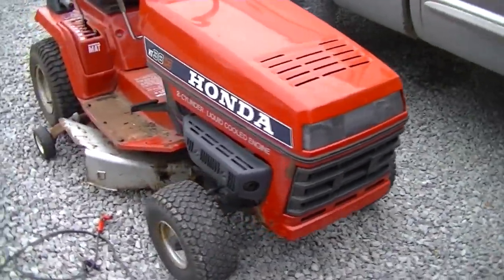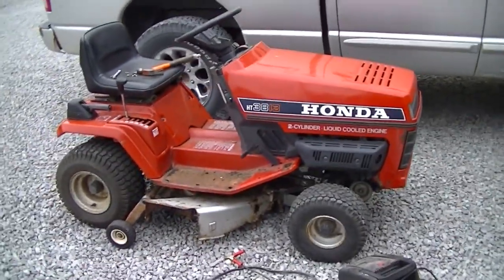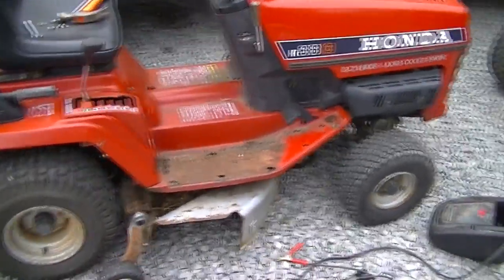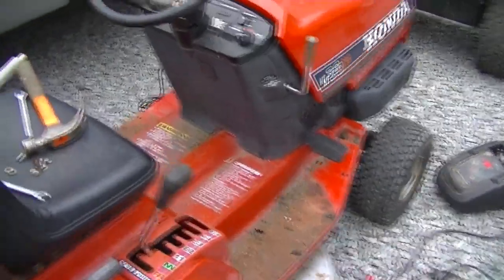That is a thing of beauty. Now I got to figure out what I'm going to do. I've got two 3813s, one reasonably decent body. Engine's not running at the moment. I think the starter's pooched. We get the click out of the solenoid, but not much else.